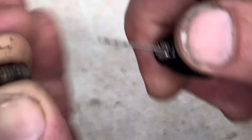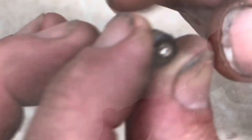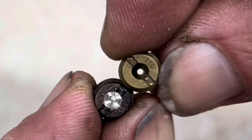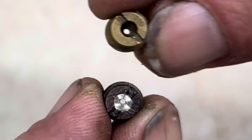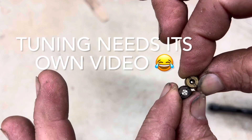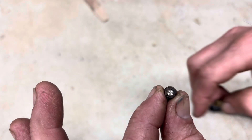So you don't want to ream it out any more than the drill size. So that's it — we now have a 0.95 jet. You can see the size difference there. That's a 1.1, that's the original jet. I tried a 1, now we're going to a 0.95. I think it's running not too bad on the one millimetre, it's just quite fat still.